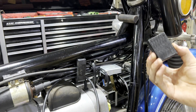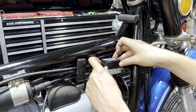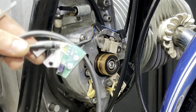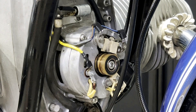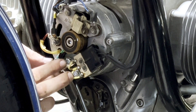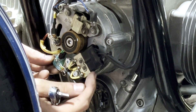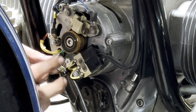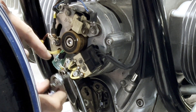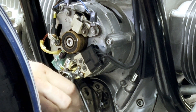And then we can mount our little control box here. Like I said before, it's kind of the brains behind the operation, and I'm mounting it with the little supplied Velcro strip. We can then install our optical pickup. In doing so, we're going to be removing our two flathead screws here. I have the two four-millimeter head Allen bolts screwed down on top of this plug here and the plate that's under it — so it goes the plate and then the pickup is on top of that. We're just going to torque both of these down and make sure you put the supplied Loctite on those threads.